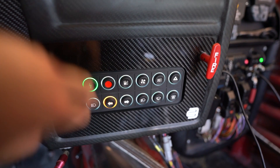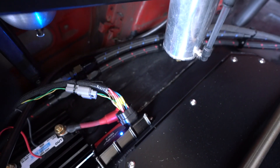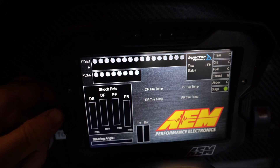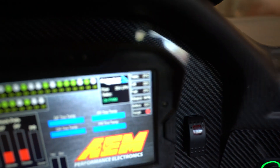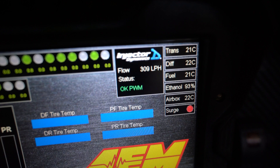Let's test out the changes. Turning on the left indicator — the CD7 sees that and the blinker turns on. Looking at the PDU, it's flashing, meaning it's receiving a valid CAN message. Next let's try the pump override. Going to the diagnostics page, you can see the state of the Injector Dynamics fuel pump controller and the surge switch. Turn on the fuel pump override to prime the surge tank — wait for the surge tank switch to turn on. There it goes, the CD7 sees that and we're all done.